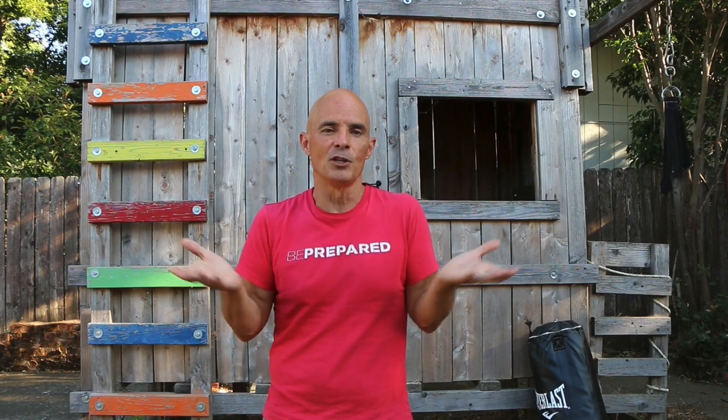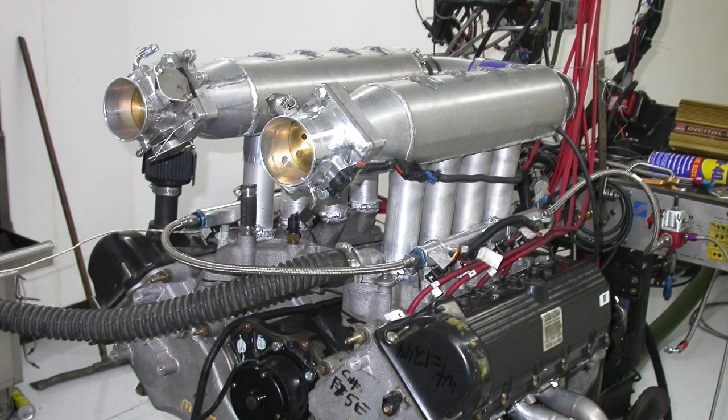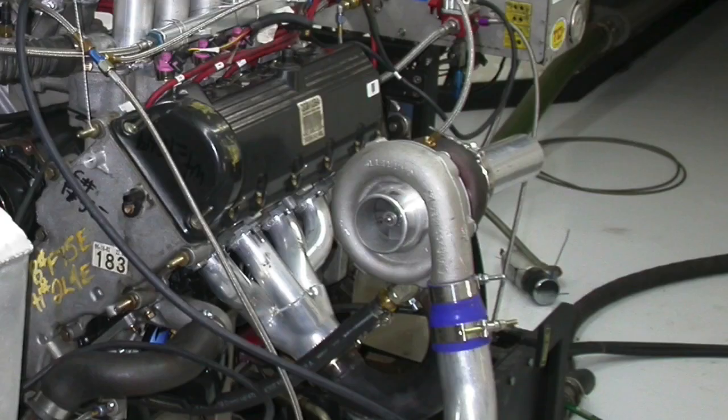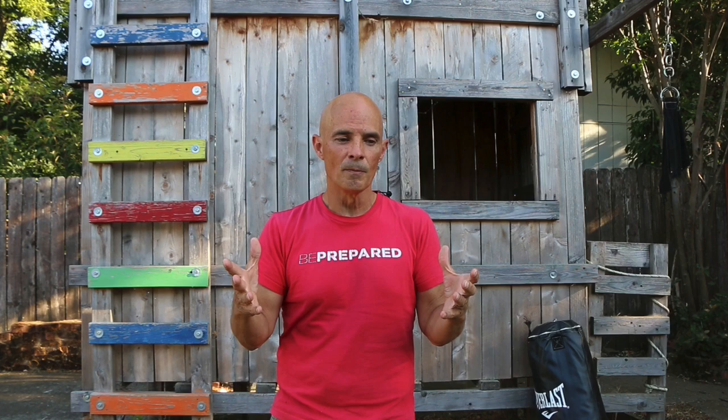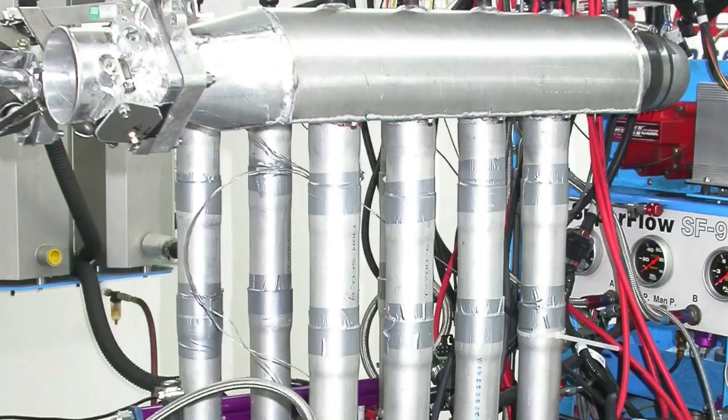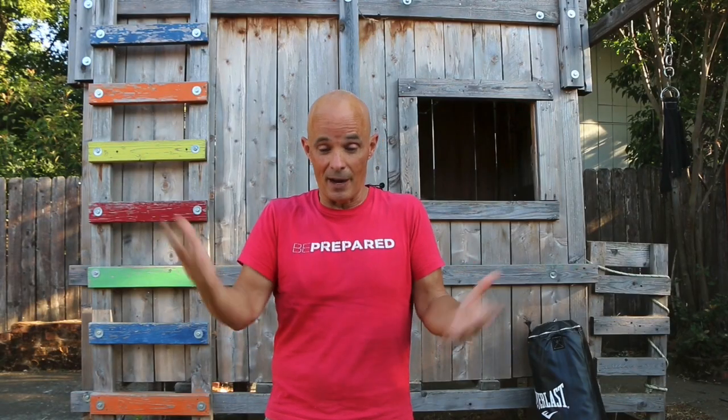On the twin turbo deal, it's a real quick story. What I wanted to do was make a thousand horsepower with a 2-valve motor. Looking back, I don't know why we thought it was such a big deal — we already had 2-valve motors making between 400 and 440 horsepower depending on what size they were; all we had to do was add boost. But I tried to overcomplicate everything and run this adjustable manifold — one because I thought it would make more power NA, and also, just look at the photo: it looks awesome. Two turbos, two outlets out of the intercooler. I even had Jimmy and Nathan over at HP Performance make me a custom intercooler with tanks that had two outlets, so I could have one tube going to each throttle body. Super cool. But here's the problem and why it didn't work — it wasn't because of the runner length, the twin plenum, or any of that. The manifold itself worked fine and made the power we wanted NA and would do it under boost.